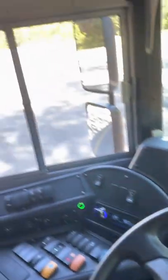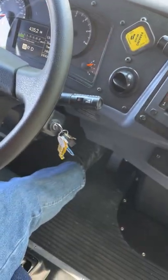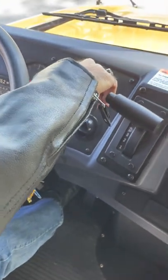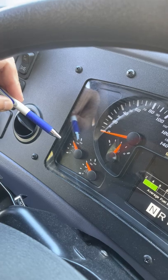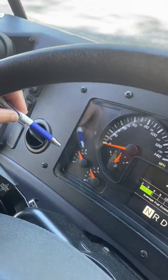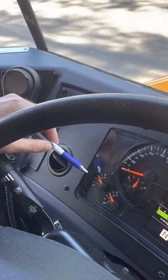Okay, we're good — that's what we just heard. Now I will do four things. First, I will turn off the engine. Second, I turn on the accessories. Third, I apply the service brake and hold it with my foot. And fourth, I release the parking brake by pushing the yellow knob. When the needles of my air pressure gauge stabilize, I look for an initial drop of no more than 15 psi. Then I ask the examiner to check my time for one minute, because the additional drop should be no more than 3 psi per minute. When the examiner tells me it has been a minute, I confirm that the extra drop was no more than 3 psi per minute.